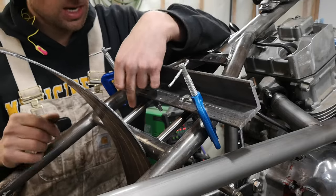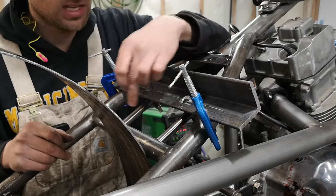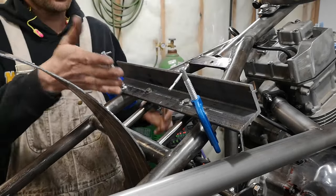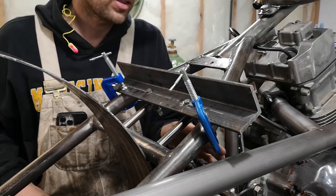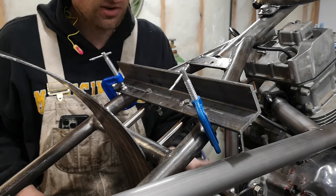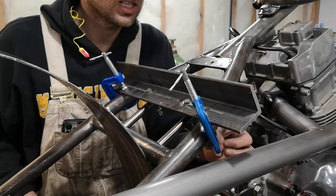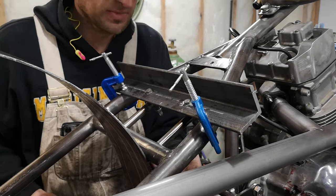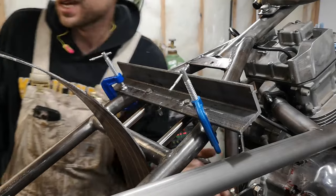I got these things made — I welded them all the way around, and then I just drilled a couple holes in this angle iron. I have these parallel to each other and centered in the fender. They are out quite a ways. I want that tank to be floating in here — I want there to be a bunch of space around it, because the more open air around it, the better job it'll do at cooling. I might have to put a heat shield on the inside of this exhaust, depending how much heat this thing dissipates. So I'm going to stitch these on, and then we can start on the tank.